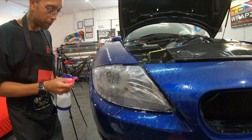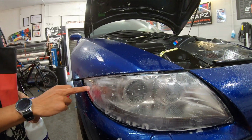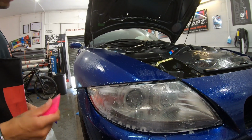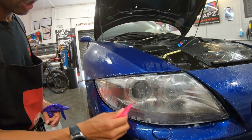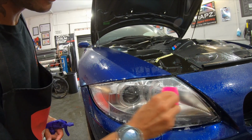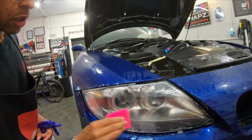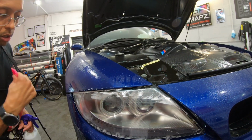and we're going to start. So I don't want to go through here. Why do I not want to go through here, Neil? There or there? Because you've got tack points and you can't release the water. You've got it. So it's tacked, can't get the water down through. So if you look, I'm bringing it all to the middle, like so. So I know now, look, my centre line, good.